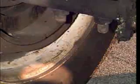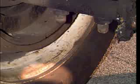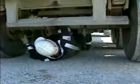Some companies choose to remove brake shoe dust covers. In this case, the inspector would be able to observe the brake shoe movement when brakes are applied. Look at all mounting brackets, springs, and cross braces. Move out of the rear of the truck.